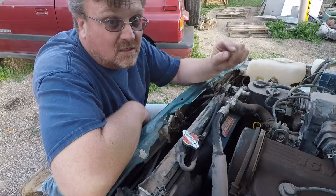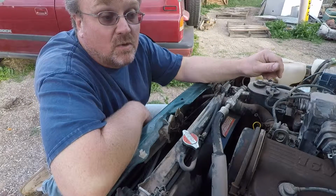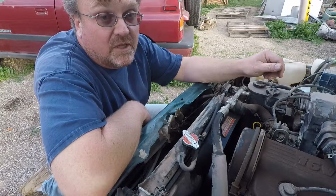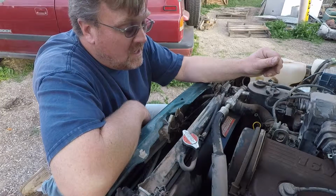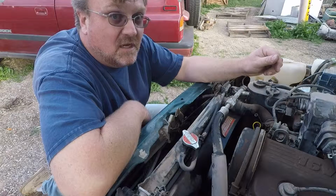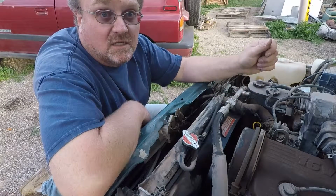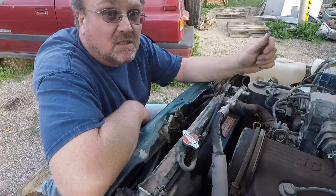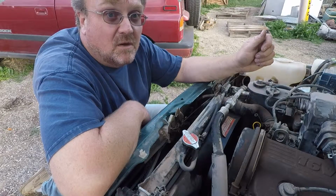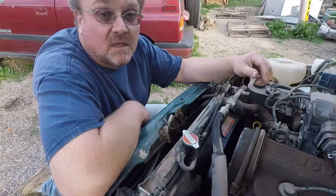Now, in the past, someone has glued over it with what looks like JB Weld, which did hold up for a while, but with heat cycling eventually it cracked and started leaking again. Now, I'm thinking that it's because JB Weld dries hard, and this is going to be expanding and contracting as the heat cycles it. So I'm thinking something soft would be the way to go, like silicone, gasket maker, blue goo, that kind of thing.